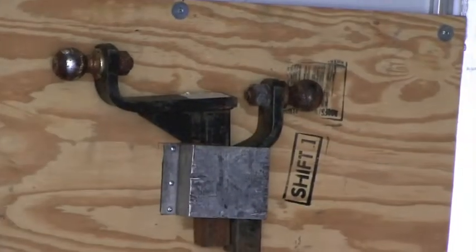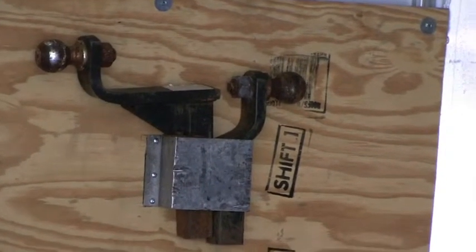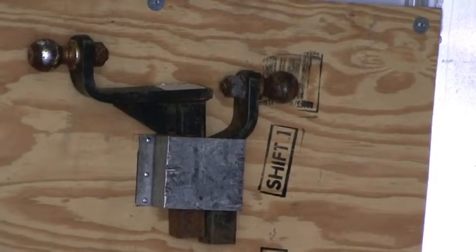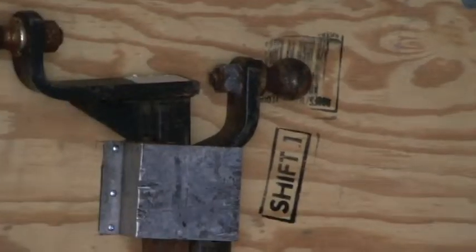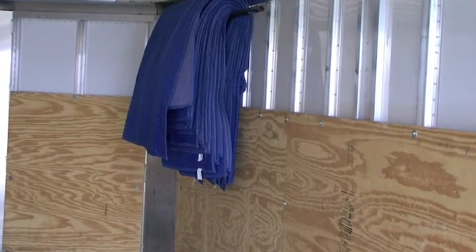Depending on the desired height of the trailer, you want to pull the trailer relatively level when you're pulling it down the street. And also you want to be aware, even when you're loading the trailer, to make sure that you're not putting extremely heavy things only to the front of the trailer, but evenly distributing the weight throughout the loading process. And of course over here are pads for you to use.